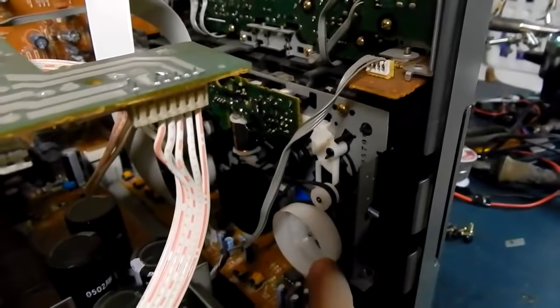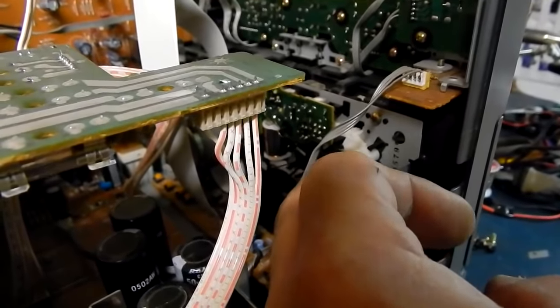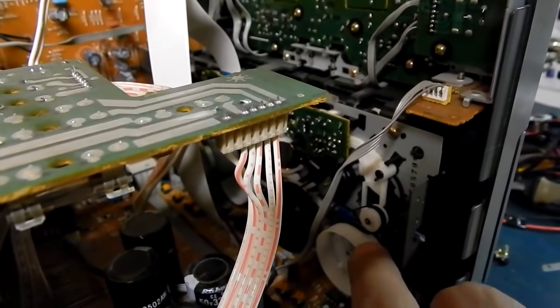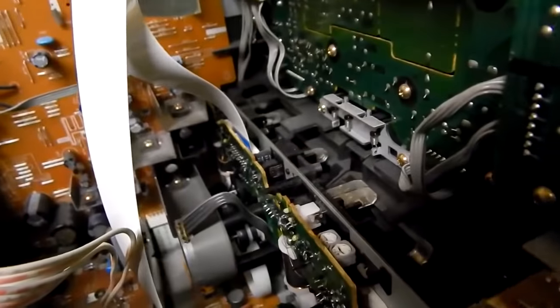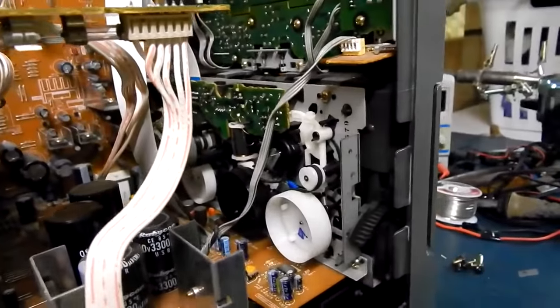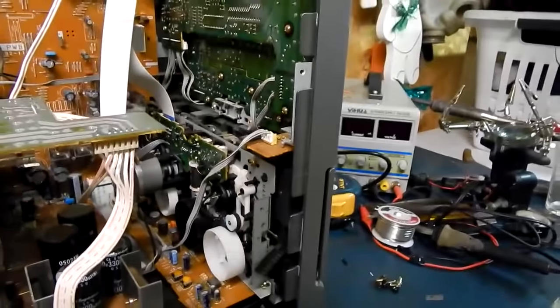Here's your tape deck. The belts still look good... well, now they feel — yeah, they're like mush. That'll never work. The belts are gone on that, I can tell you that right now, but it would be easy to replace. You don't even need a tool to remove that one.